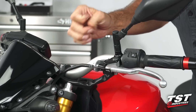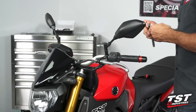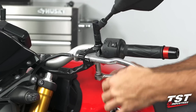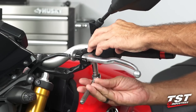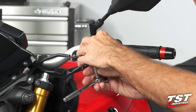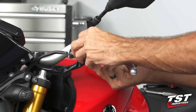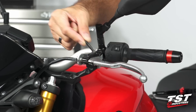Once that's out, it's pretty straightforward beyond that. I'm going to remove the nut — there's one single 10-millimeter nut that's threaded onto this pivot bolt. The pivot bolt is a carriage bolt-style fastener in that it's keyed, and it doesn't need any sort of a tool holding it from the top. I'll show you guys that in just a second. Once the nut is off, we can push the pivot bolt through. You can see the key on this bolt.